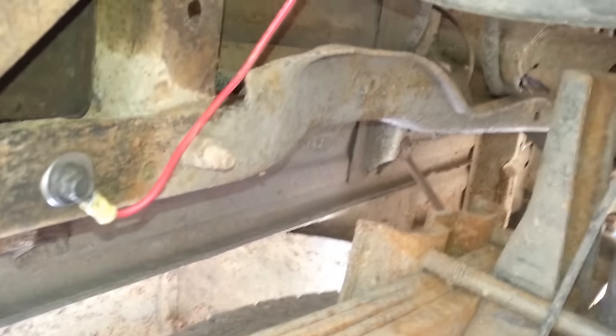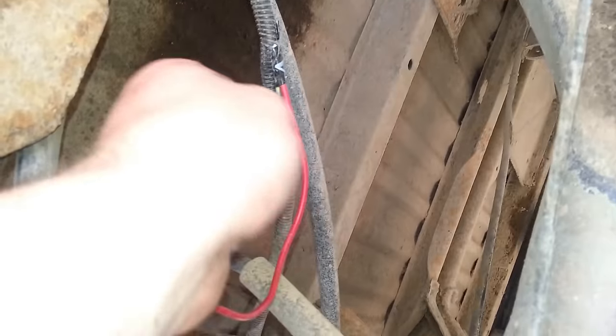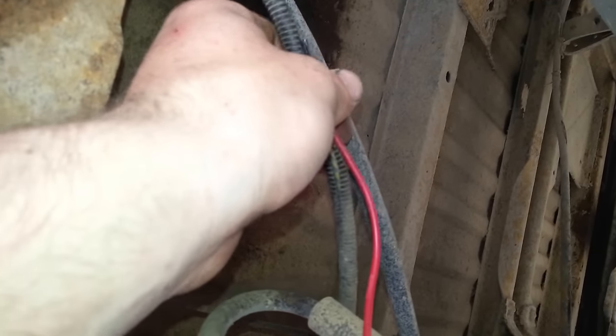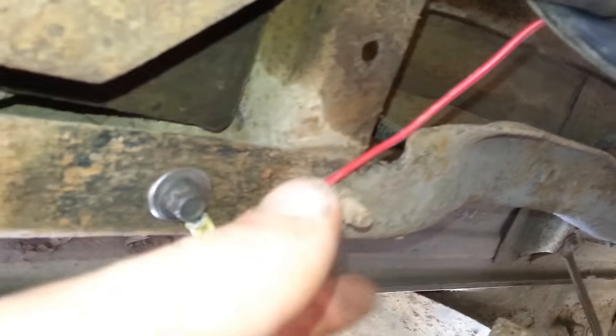Here is an actual video of how to fix the fuel problem where it doesn't show on your gauge, or if it's jumping around. You just run your ground off your body straight to your negative, your float level — your black wire. People don't show you exactly how to do it; they say how to do it but it can be confusing.